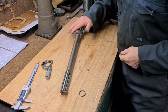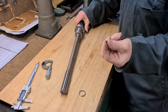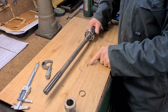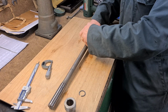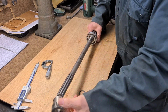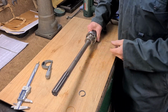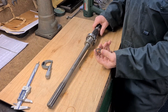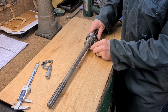This is cooled down a little bit now and it's gripped, but while it was cooling down I realised I missed out this. This is what they call a woodruff key, and there's a slot in there to match, and there's a slot in here to match, so that's what drives the speedo gear. So I didn't want that spinning round, so now I've got the task of getting this clip back in here, and it seems quite good. Seems quite a snug fit in there.